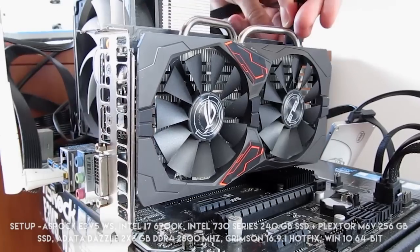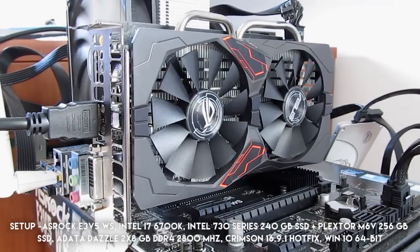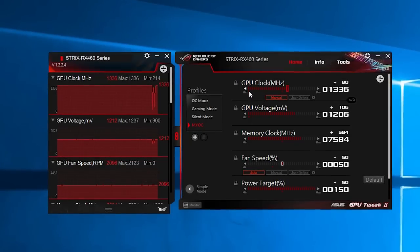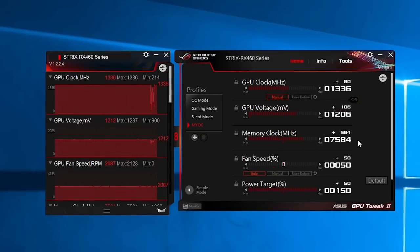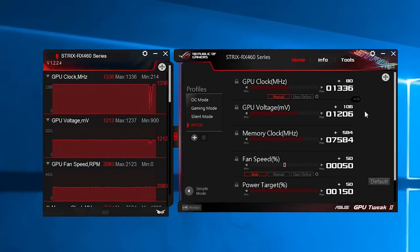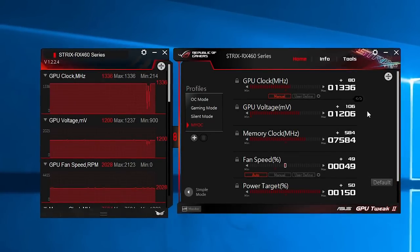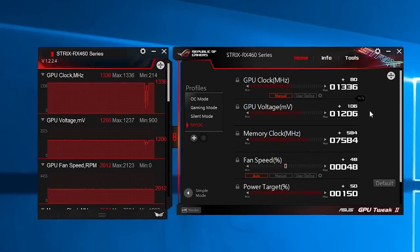Taking the card for a spin, the RX 460 turned out to be a pretty average overclocker, reaching about 80 MHz more compared to the stock GPU core clock speed and around 150 MHz more on the video memory. Although this is not an impressive result, it's still a free performance booster, and for achieving that I've used the Asus GPU Tweak II software, which is basically something along the lines of MSI's Afterburner and Sapphire's TriXX